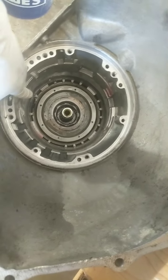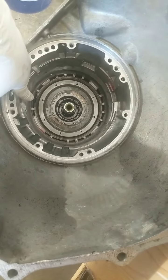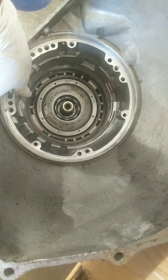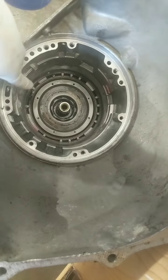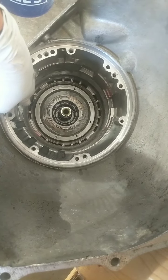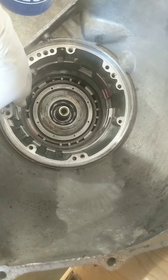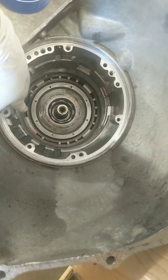Here's a scenario: if you put that snap ring in and it is too close to where it bumps that clunk spring, what will happen is this snap ring is only a set diameter. If that snap ring is not engaged in that last tab and you have it shifted over, when this pressure plate clunks up against that spring, it'll bounce that snap ring out of place.